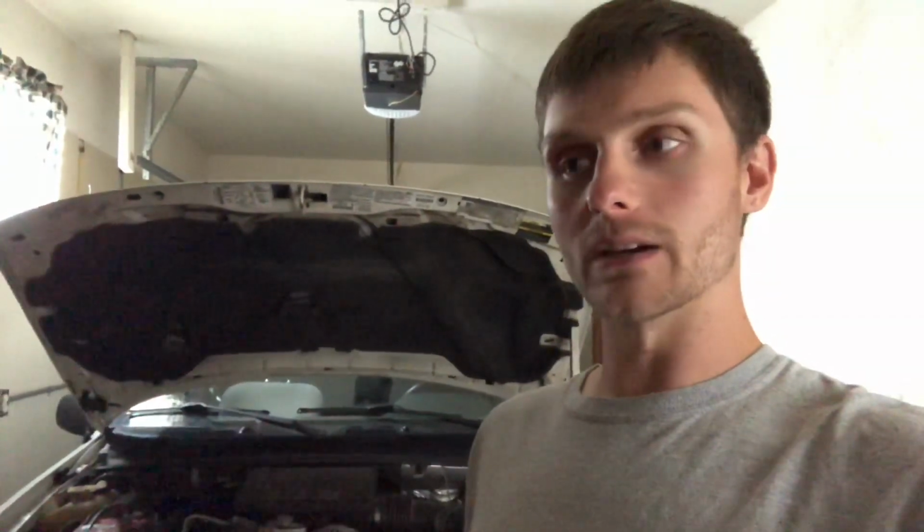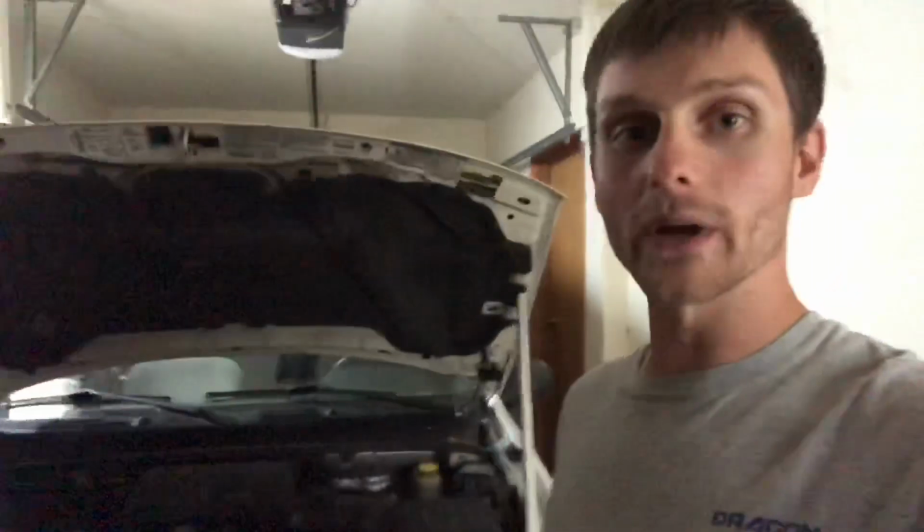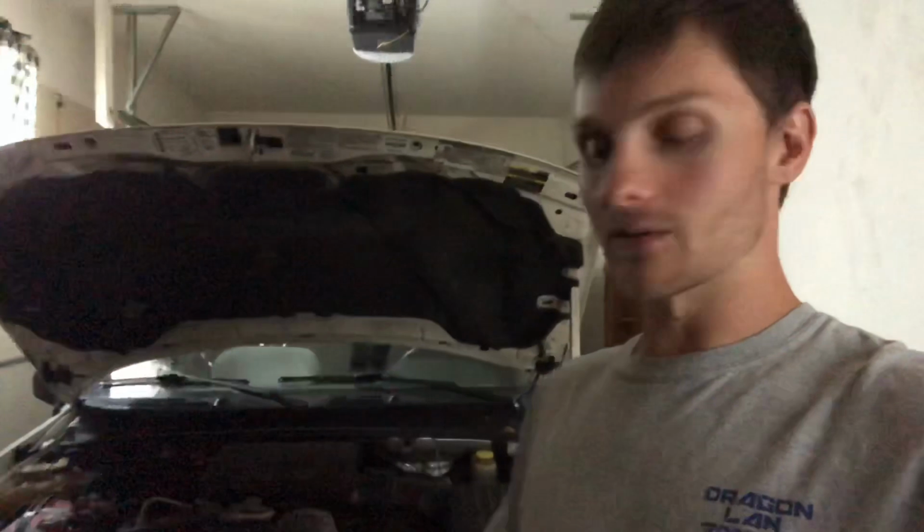First, we're gonna take the fuel relay out, and maybe a fuse if there's another fuel fuse, so that the fuel is not running. And then we're gonna take off the intake up here, take all the coil packs and spark plugs out, and then we'll plug this tool in. So we'll just take this piece, put it down in the hole where the spark plug's at, and then tie the gauge onto there, turn the key.